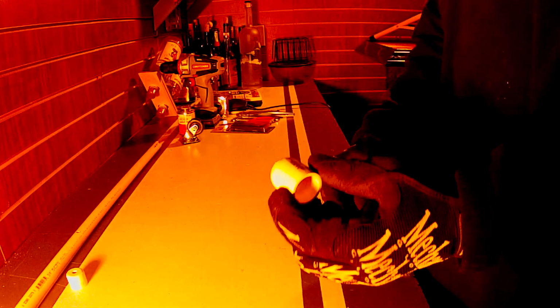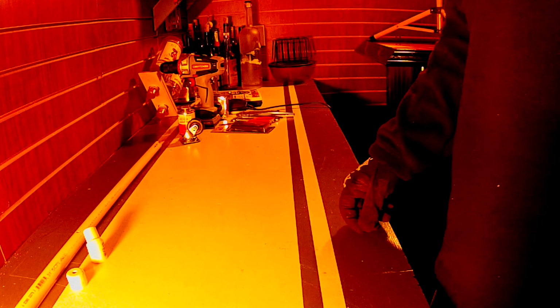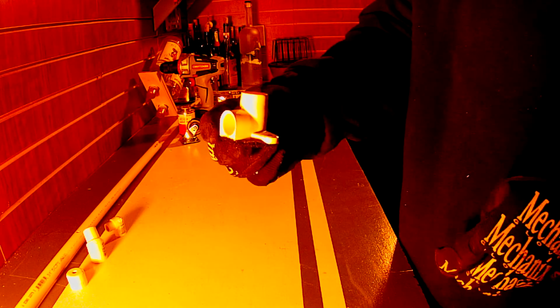You'll need a 3/4 inch to 1/2 inch 45 fitting. You'll need a 1/2 inch street 90. It's a street 90 because it'll go right into another fitting without having to have a piece of pipe there. And this is a winged 90-degree fitting. That's the only thing I know. It's a wall mount fitting, and I've got Velcro on the back side and a hole drilled through there, and a short 1.25 inch piece of 1/2 inch CPVC.